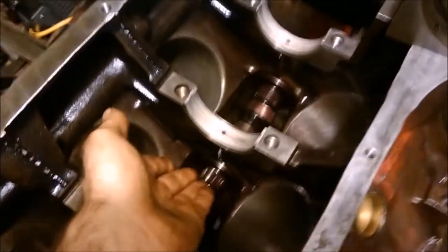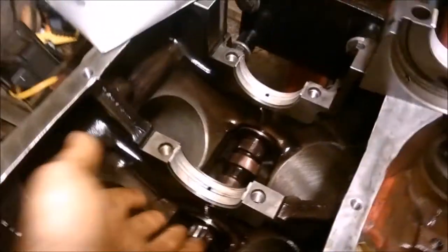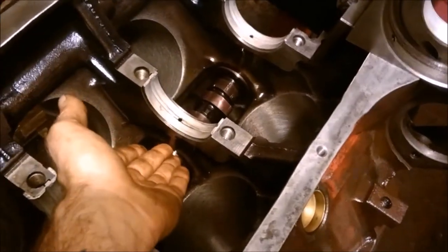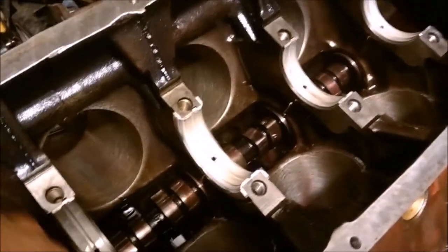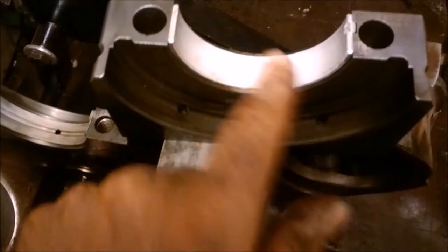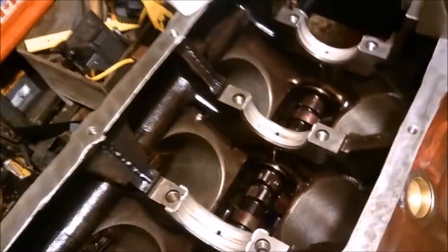When the cam was out, this is when you would have used your caliper or micrometer to check — actually your bore gauge would work. I use my micrometer to check cam clearances from the inside diameter of the new bearing versus the outside diameter of the journal. Wipe these dry, do the same for the caps, and we'll set our crankshaft in place.